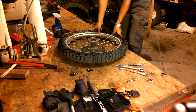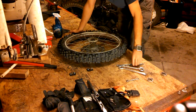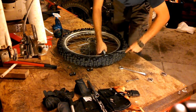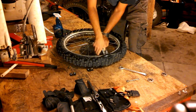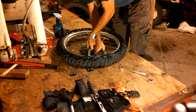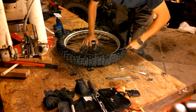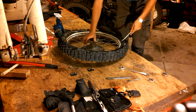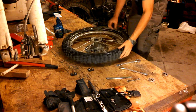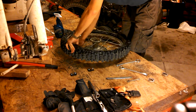I start on the opposite side from the rimlock — but not just 45 degrees, I push the tire in and work it so the tire is pushed off the rim. Once it comes off the rim I use the slim tire iron to grab the tire and take it out, holding it with the thicker one. Then I work my way around. I always start opposite from the valve — I put my fingers under, grab the tire tube, and pull it out.